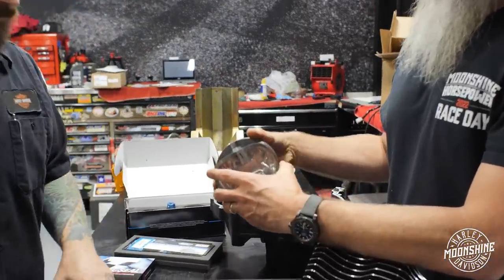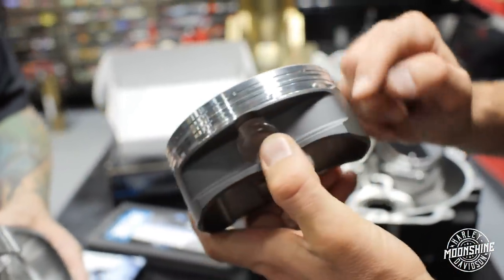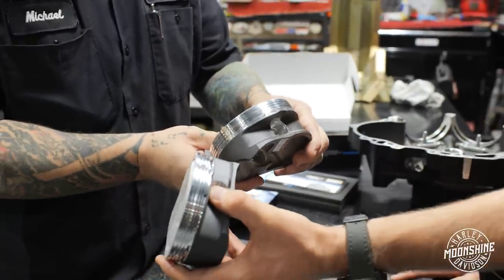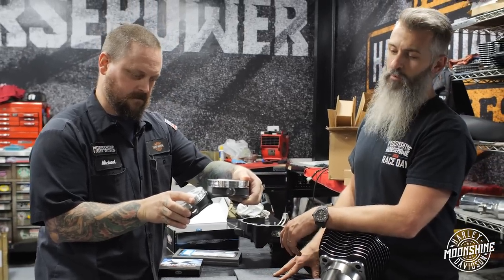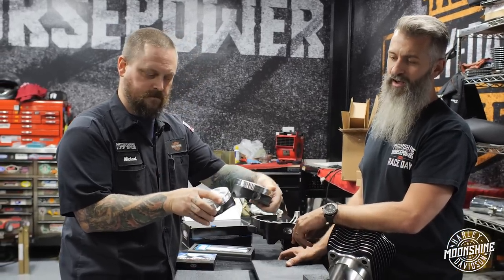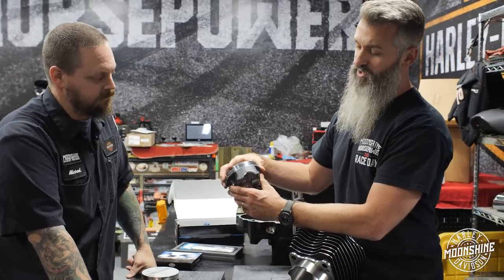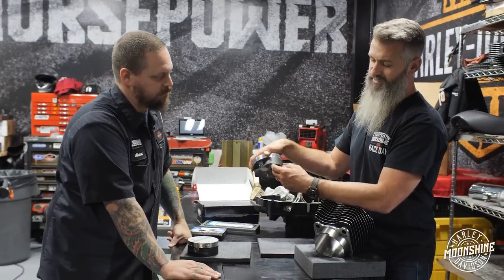If you're new to the channel, this is a front piston and this is the rear of the skirt — your major skirt. We don't want to remove material from the major skirt, so we take all the material from the minor of the rear piston. A lot of other piston designs remove a little bit of material from both pistons, but if you remove it from the front or rear of the front piston, you're removing material needed for the force on the downstroke, mostly on your compression stroke. We remove it from the front — the minor — which doesn't need the support because it's not being crammed against the cylinder wall on the compression stroke.